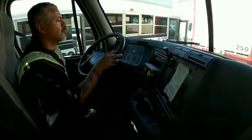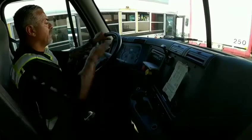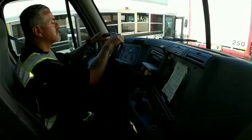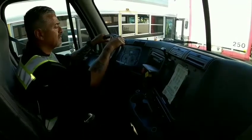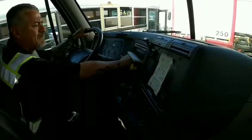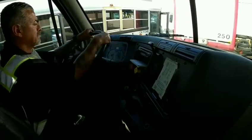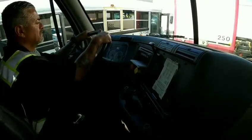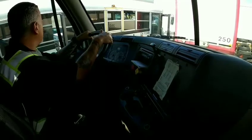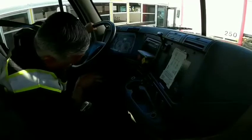When you shut your engine off, turn the key back on the ignition and wait for all the indicators to stop, then proceed. I'm going to release my parking brake and my trailer brake. I'm waiting for my pressure to stabilize — pressure has stabilized.